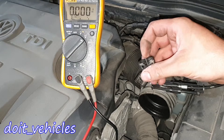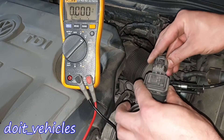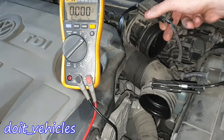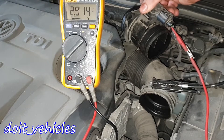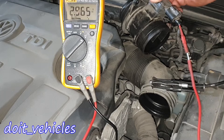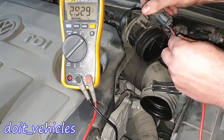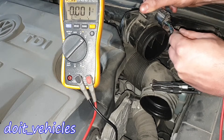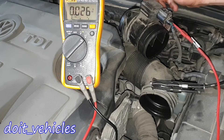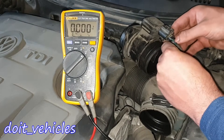With the cover off the connector, I'm going to connect it onto the sensor and check the voltage values now. Connecting to ground, I read 2.8 volts on the signal wire — you can see it's fluctuating. Once I create some airflow, the voltage changes; this is possible on this car. In the middle we should find 12 volts, and the reference wire is now passing through the sensor, so we read nothing there. I'll turn the ignition off and install the cover back.